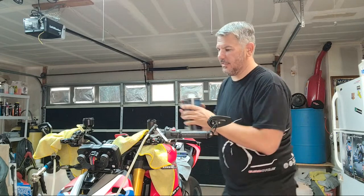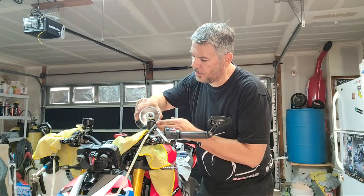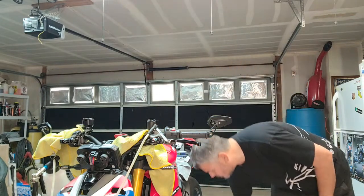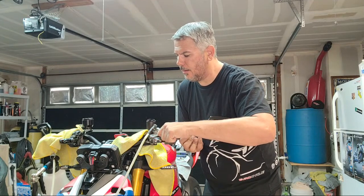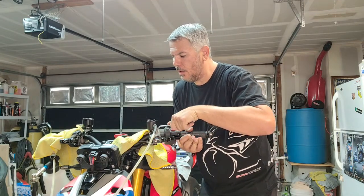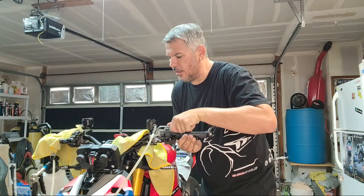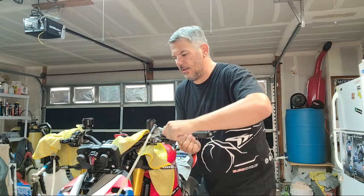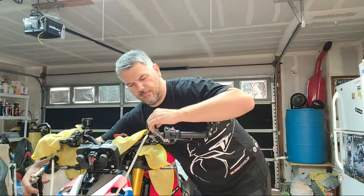We're just getting the system bled. So get the master bled, and then we're gonna run all new fluid through this thing. So we're just kind of getting all the air. I can hear it in the lever, so that's good. And I think we're good there. Pull this off.